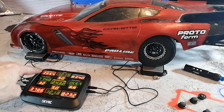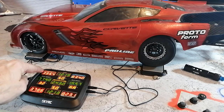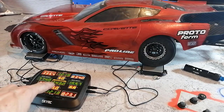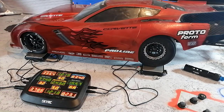Personally, I don't think having all the weight on one side is important at all. I think it's more important to have the cross balance weight better set up. As you can see here, my front right is heavier than my front left, but at the same time my rear left is lighter than the rear right. So the extra weight from this side is going to compensate for the lack of weight on this side, and vice versa.